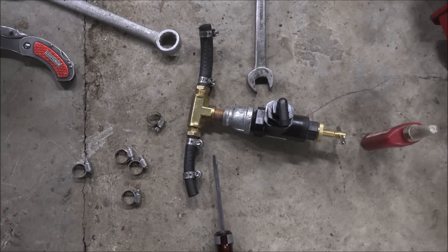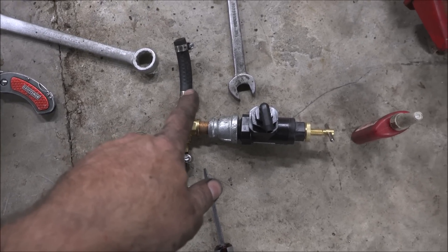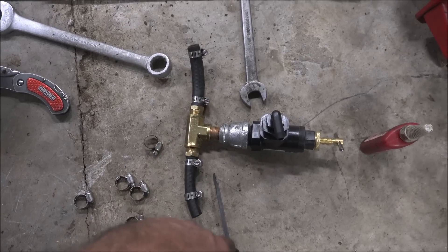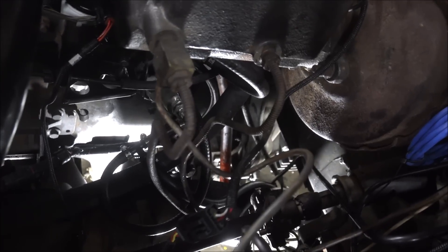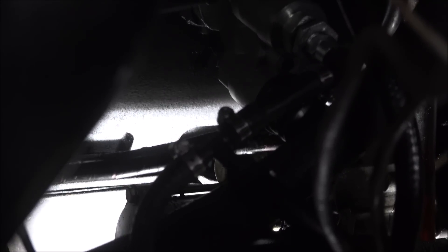So thanks to Rule King, I have a fuel pressure regulator rigged up — pressure out, fuel return back to the tank. That auto-regulates the fuel pressure coming out of the pump so it doesn't blow the seal out. I've just cut the factory line coming from the injection pump to the head and I'm going to put this in between it. You'll notice there's a T in the fuel inlet side. I had to route the return back to the fuel inlet because for whatever reason my return back to the tank couldn't handle that much fuel — I couldn't get the pressure to regulate. So I just ran it back into the inlet side and now I'm able to keep the fuel pressure down.